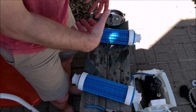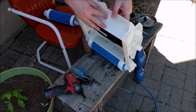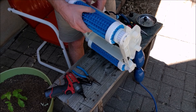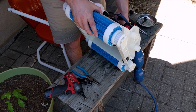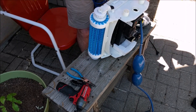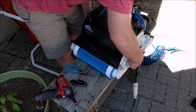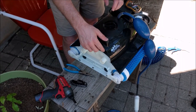The next thing we need to do is put everything back together. It's a little bit more difficult than taking it apart — the belts are particularly annoying to do. So in order to put this back together, this lip here needs to go on the inside of this right here. It'll go just like that, and then the same thing for the other side. I'm going to go ahead and reinstall the top here. When you put it back together, make sure that the shell is back in the grooves along here where it should be.